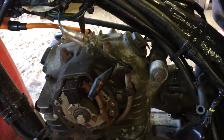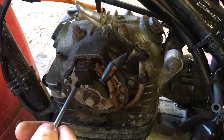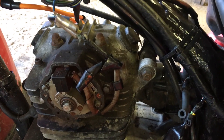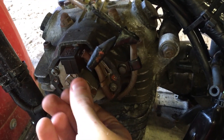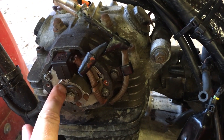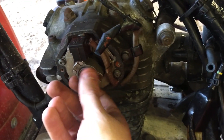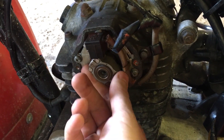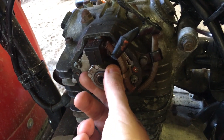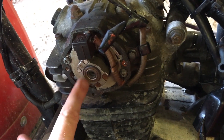You can tell this is a magnet and this is the sensor because when I bring a screwdriver close, you can see it wants to stick to it — it's magnetized. They use that magnetism to help the sensor identify when the lines are meeting. Another thing to note: sometimes you can get a bit of in-and-out play if your bolt is not tight enough, and that can cause a bit of top-end noise.